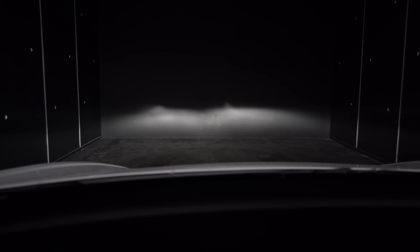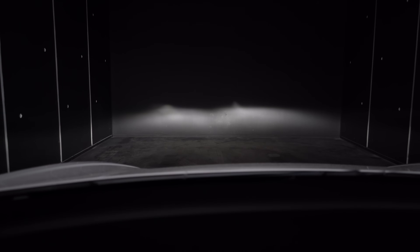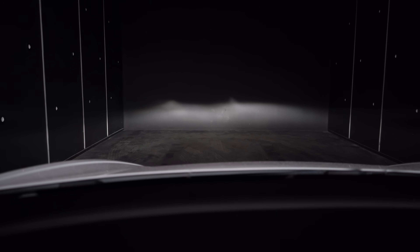What I should see is that the headlight should actually come up on the wall slightly as I get closer — it's just lifting up a little bit — which means if I'm closer and then I go backwards again, the headlight should go lower on the wall as I reverse. So fundamentally this is testing that the headlights point slightly downwards rather than upwards — that's the key thing.